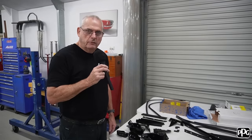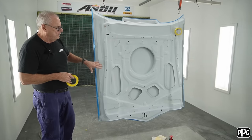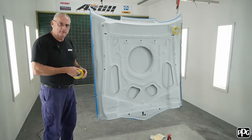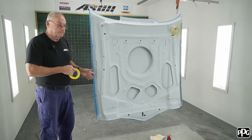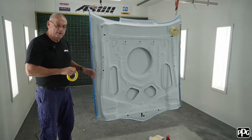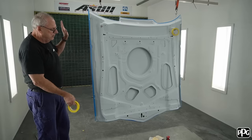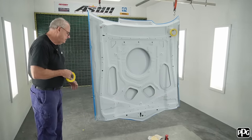The last job — I've just got to do the underside of the bonnet now. I've sort of left it because the bonnet's been sitting on the table with me rubbing and polishing. I'm going to hit this wet-on-wet with the Delfleet — I'll put the 4949 down and then put the matte, and that'll match everything else in the engine bay. I'm masking off with some fine line so I'll keep all my blue edges and the rest will be black.